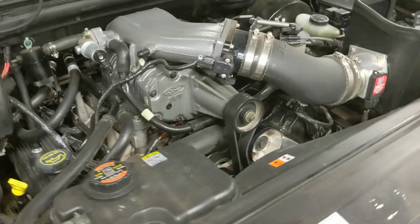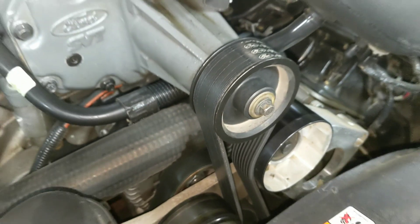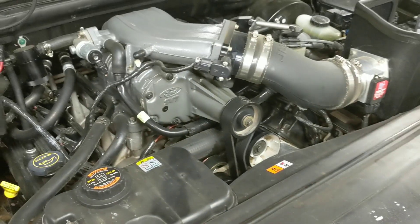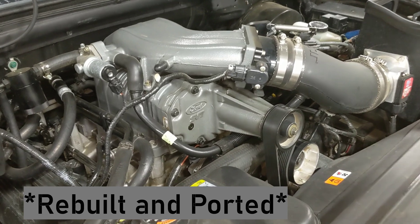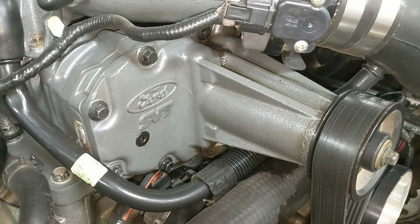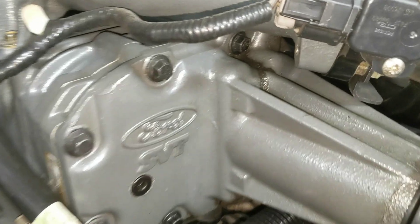It's another night here in the shop. If you look real close you can see that supercharger is leaking - coming down here, getting in behind the snout and spinning out all over everywhere. You can see some on the intake right there. It was actually rebuilt less than two years ago, so kind of a bummer. I'm going to take the belt off, pull the snout off, and reseal it with some Loctite 515, which is an anaerobic sealant, and hopefully that does the trick.